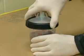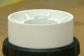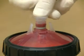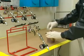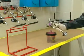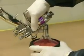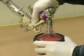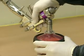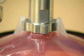If the paint needs to be shaken, the 3M Paint Preparation System shaker core is used to protect the mixing cup while it's clamped in the shaker. The lid can be sealed with a plug, or if the paint is going to be used immediately, the mixing cup is fitted to your spray gun. With the mixing cup upright, the gun is inverted to fit over the lid and locked in place with a simple half turn, making sure that the lid fingers fully engage the adapter.